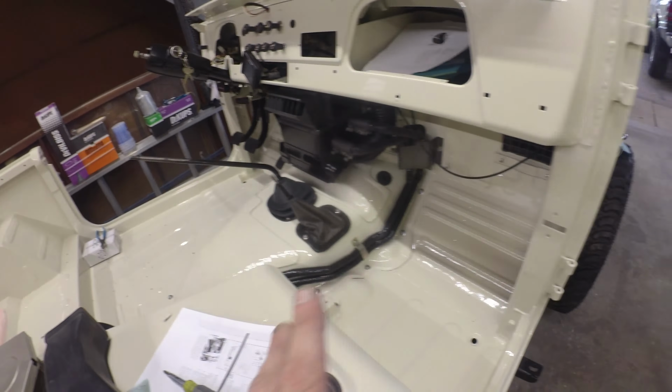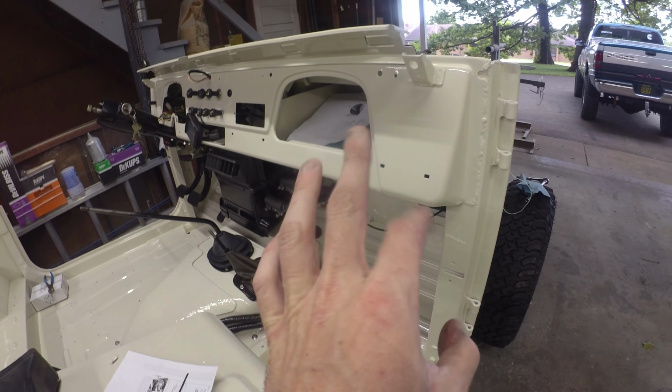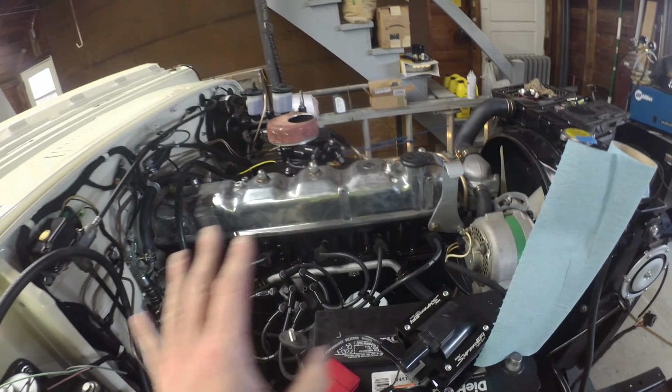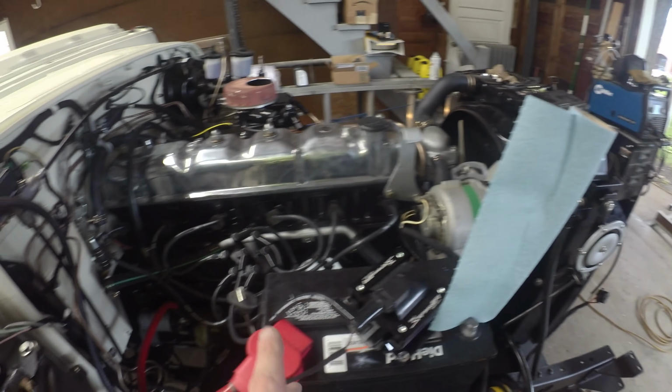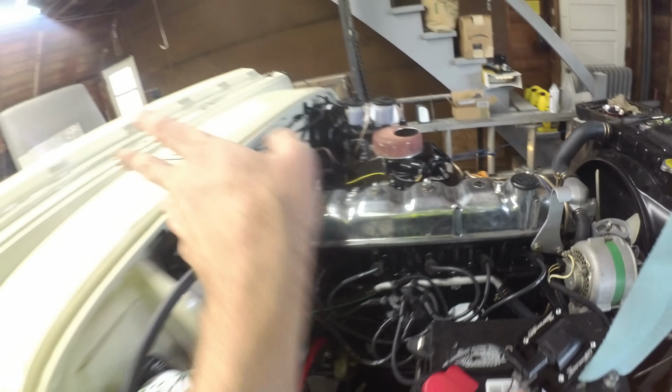So heater's mostly in. At least I have all the coolant lines tied up, so we can actually dunk some antifreeze in the old girl and get the system burped. So that'll be nice. Then when we run it, it's got coolant in it. It did have water in it when we did all the test fires. Everything burped there, so everything's working. Thermostat opens, radiator doesn't have any leaks, yada, yada, yada. We will have to check anything we mucked with, which is basically this heater valve and then back through the firewall. But getting closer and closer to having a dash that looks like a dash. It's kind of nice to have that heater back in out of the basement. That was one of the first things I cleaned up, but just one of the winter projects.